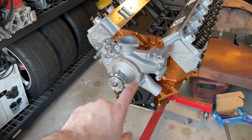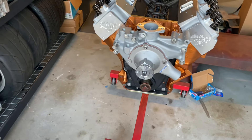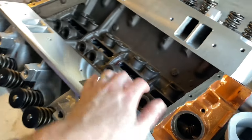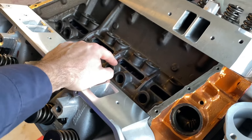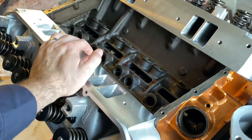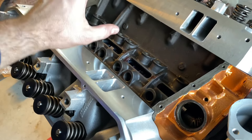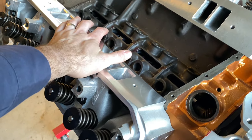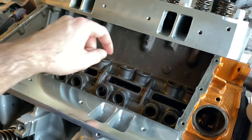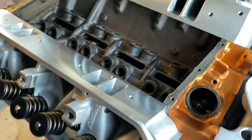Now that the water pump housing and water pump are on, I'm going to let the oil pump keep drying — I just got a couple of coats of paint on that. Now I'm going to tackle the lifters. This cam and lifter set, if you remember, was already used in a dyno session — it was broken in. They didn't like the power specs on it, so they swapped it out for a bigger cam. It was used from 1990 and has been sitting on a shelf ever since. So it's critical that I match the lifters to the cam lobes they were already married to. I already have that done, and now it's time to put them back in.